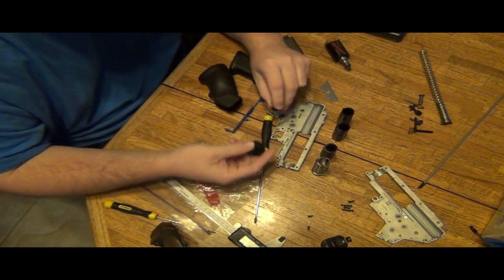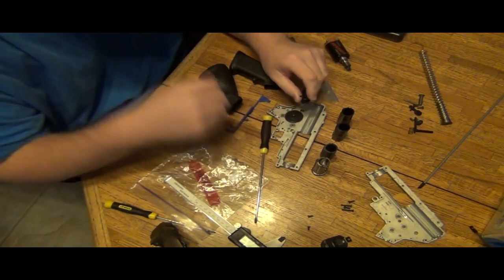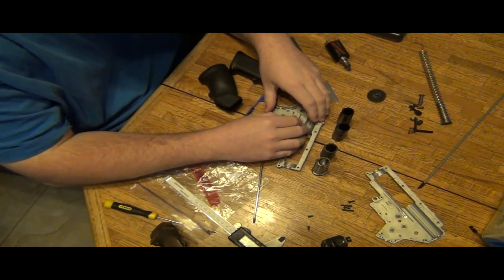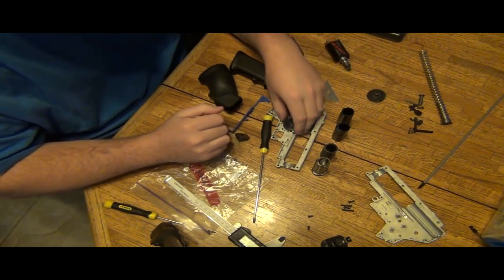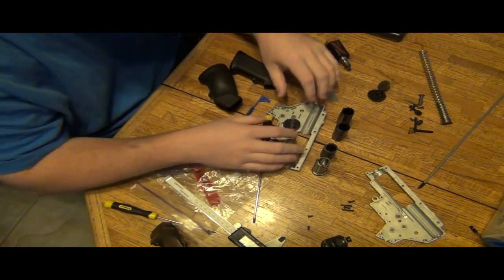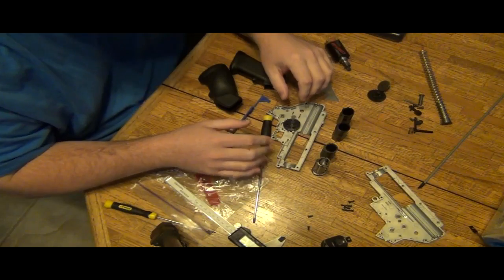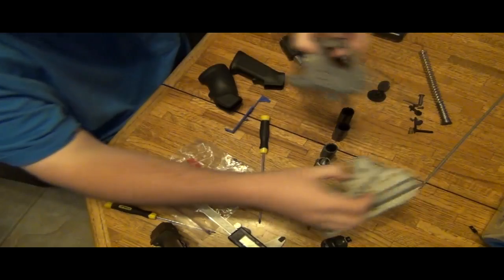Okay, the reason for this is that when you go to check the shimming, you don't have any of that debris or any grease that prohibits the spin. For instance, right here you can see it spins a little bit better. Now, the thing to note about spinning is you need to know why it spins more or why it spins less under certain conditions. I'll take this gearbox shell, for example, over here.